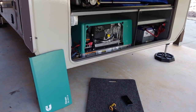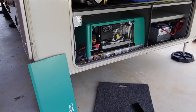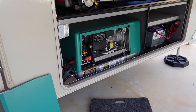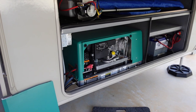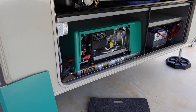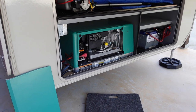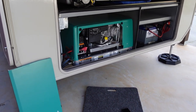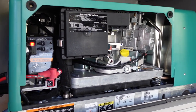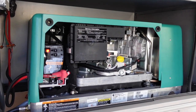If we subtract the idle amp draw of about two amps, that leaves us with exactly 100 amps. That's a lot less than I expected — remember, online sources were saying 400 to 450 cold cranking amps would be required. Granted, it's not zero degrees outside; the engine block was more like 42 degrees. But it's hard to imagine it going all the way up to 400 amps even at zero or 10 degrees outside. While we've got everything set up, I'm curious to do a second test now that the generator is warmed up.